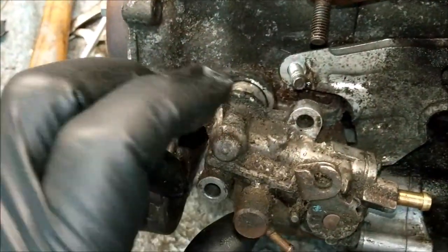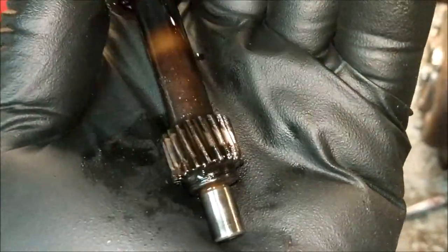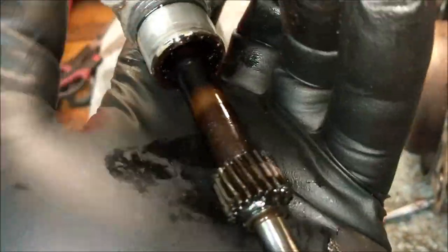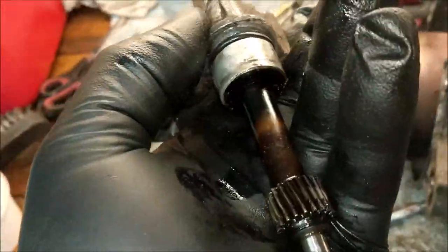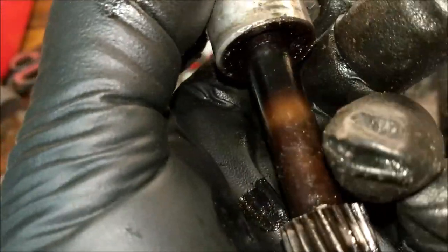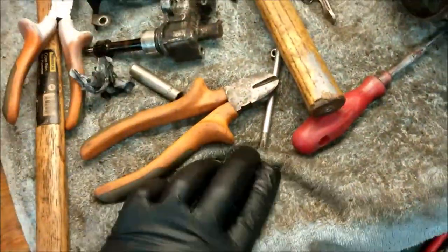Okay. Ooh, okay. It's all new to me. Well, the gear teeth look fine. There's a lot of blackness, isn't there, on that shaft? Therefore, that shaft is obviously in the crankcase area. So that says to me that's seen an awful lot of heat as well to go that colour. Right, so that needs to be part cleaned and checked.